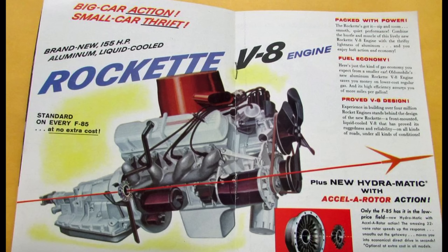It had some pretty terrible shift patterns with a very short first gear. The 1-2 shift on these Rotohydromatics is very noticeable — the transmission not only upshifts but also engages full mechanical lockup. So the engine really dies down in RPMs from 1-2, kind of similar to what the old-school Hydromatic would do on the 2-3 shift, although these Rotohydromatics are far less reliable than the original Hydromatic was.